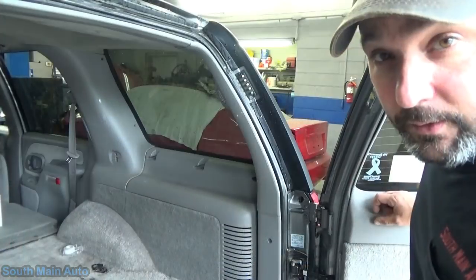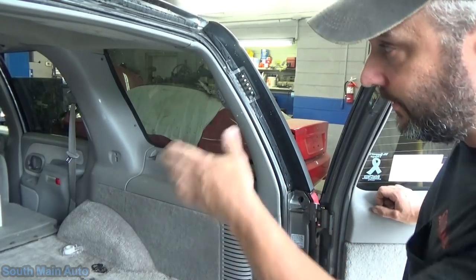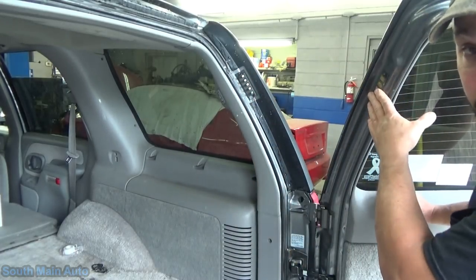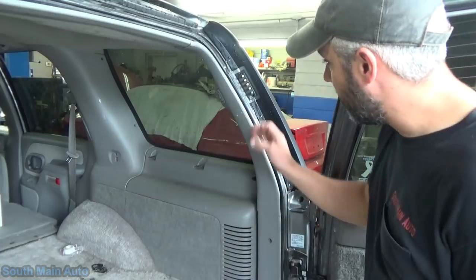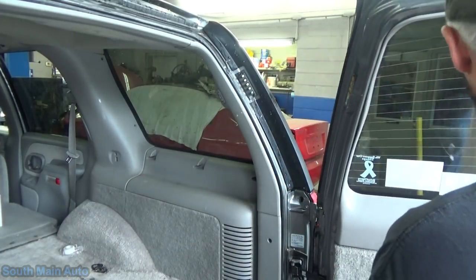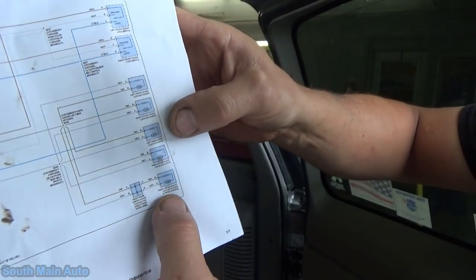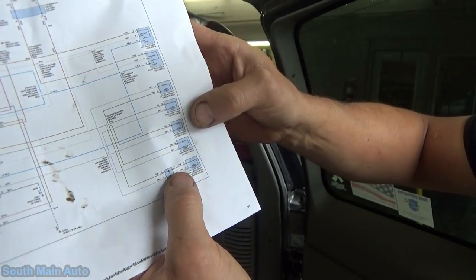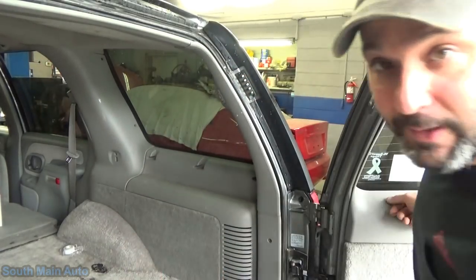Definitely not locking. On these rear door systems they don't have your normal flex joint like you'd see on a door — the rubber joint. They use contact buttons up here, and there's a corresponding contact plate on the door. I grabbed us a wiring diagram, and we can see at the bottom we've got our rear cargo door lock actuator for the cargo style doors. It goes to pin A and B — not really sure which is which, but it would be two that are close to each other.